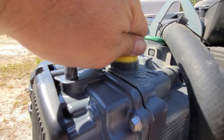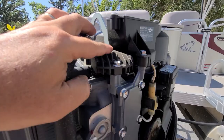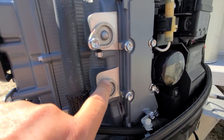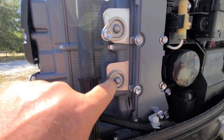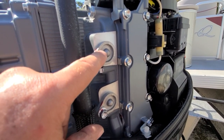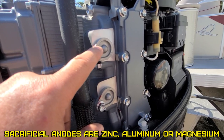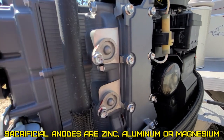This must be where you fill the engine oil. The thermostat opened. That's the regulator rectifier. These are actually anodes. If you keep it in the salt water, or use it a lot, you're supposed to replace these. An anode takes the corrosion before the aluminum does. They put them in hot water heaters too. I think it's magnesium — it just attracts the corrosion, so it'll corrode this before it does the block.